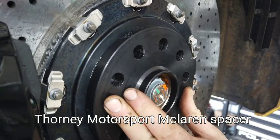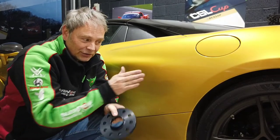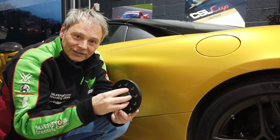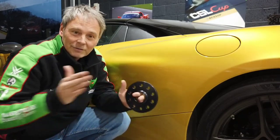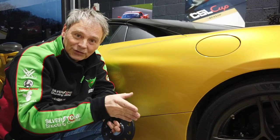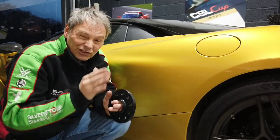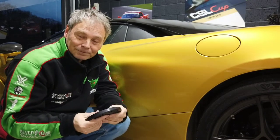If you have a choice between no spacers, ours, or other ones, I would still recommend getting some spacers — it does make a difference to the car. Aesthetically it brings the whole car wider. Ours are 12mm spacers. Anything bigger than 12mm and you'll find the spacer doesn't quite sit rock solid on the face. The beauty of spacers is that they simply create wider lateral grip — 12mm per side means 24mm wider overall. We originally designed these to take the 12C to match the same wheel track as a 675LT, and since then we've added them for every model: the Sport Series, the 720S, everything. It makes a huge difference in lateral grip, doesn't make a blind bit of difference in a straight line, but laterally you are simply making the axle track wider, which by definition gives you more grip.